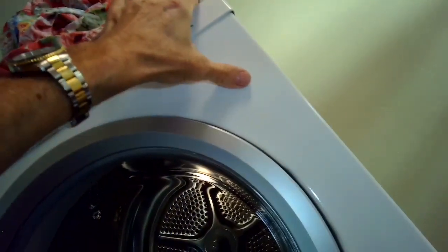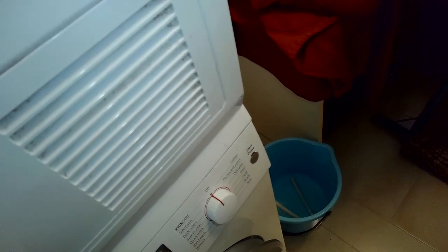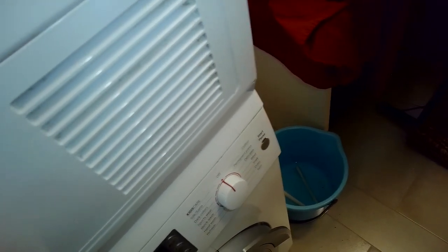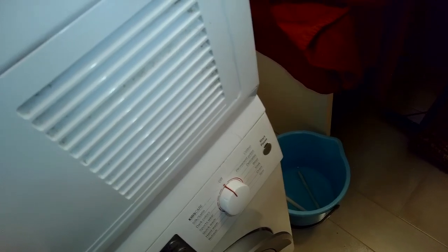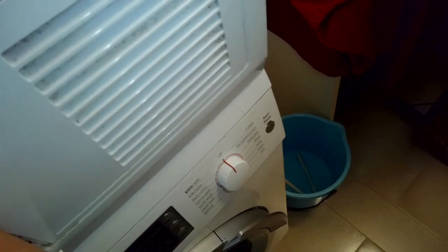When I turn it on, I know there's water caught in the sump, but it's not getting rid of it. I can feel to the left where the pump is, and there's a little plastic tab that I can lift up on, which is the float. When I reach all the way to the top, it should activate the pump and get rid of the water, but that's not happening.